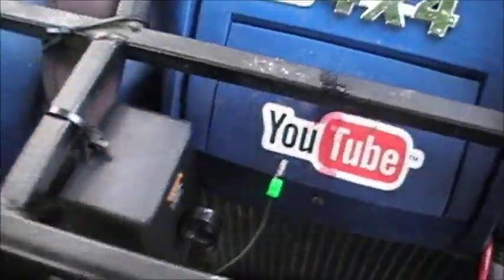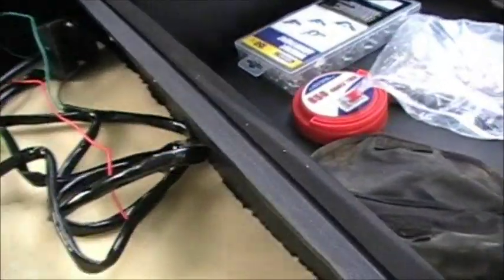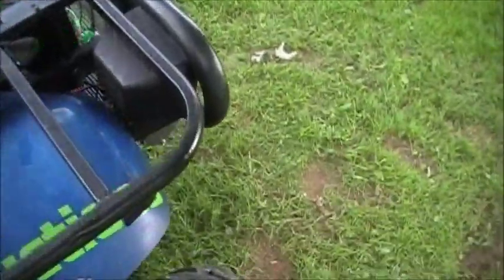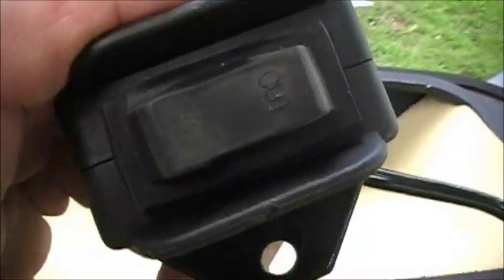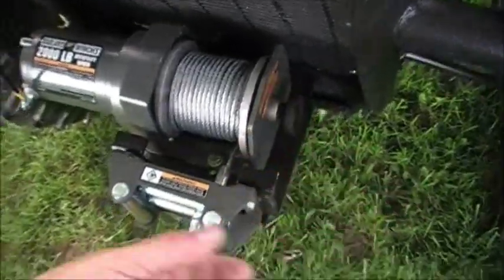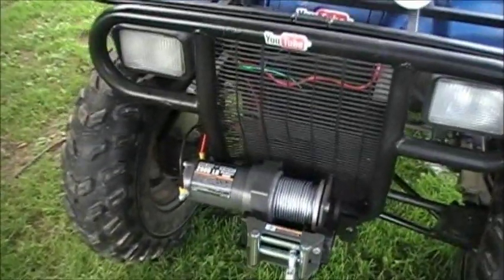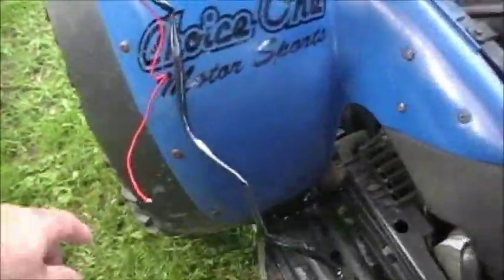The two wires for the switch just buckle right in — it's optional whether you leave it connected or not. The cord is long enough that you can be way off to the side and still use it. This winch has an in and out — it's not a free-floater. On the 1500-pound model you have to pull a knob out on the side to pull your cable out manually, whereas this one will feed the cable out electrically, which is a nice feature I like.